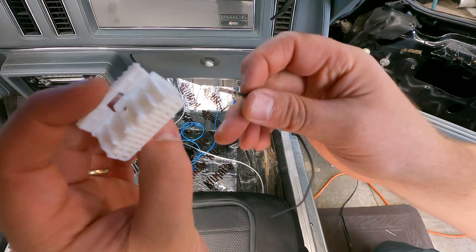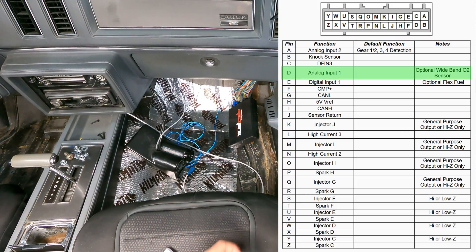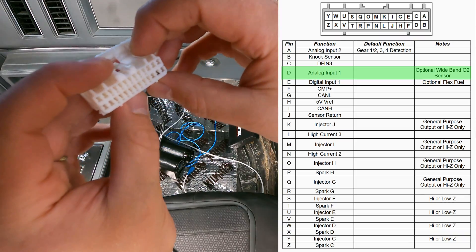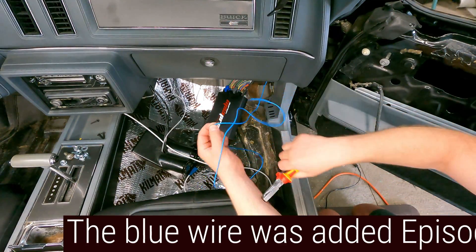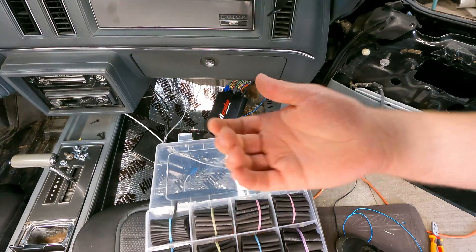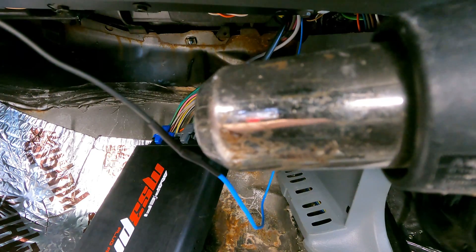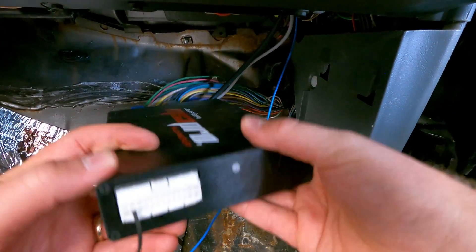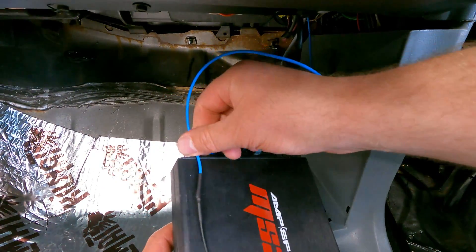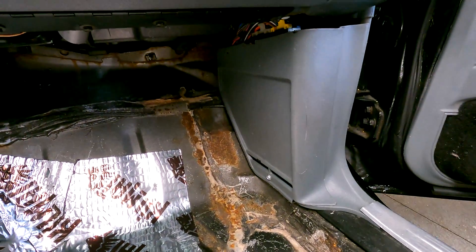Here's the connector to hook the AFR gauge to the ECM. We want pin D. This connector on the ECM is sort of optional, but what it does is this is where you hook up the extra sensors. It's this blue wire that needs to connect to it. A little piece of shrink wrap — nice solid click. And then I got to run this wire up here, so I think I almost might want to tape it to the ECM. At long last we've got the ECM installed where it should be.